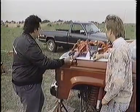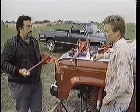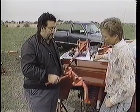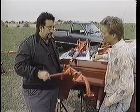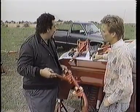Yeah, let me go into this cross-member, which adds integral strength and mounts the sway bar. We didn't want to lose the sway bar for street performance, so we made this tubular crossmember. Also, on this tubular crossmember, we mounted a support tube that ties in with one of our new frame brackets. That's to help keep the factory crossmember from wiggling. It gives added stability to the front suspension.